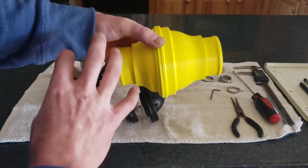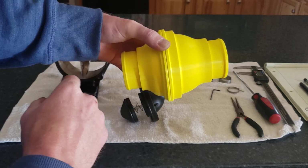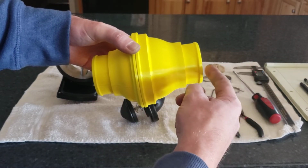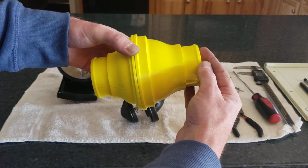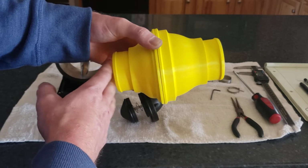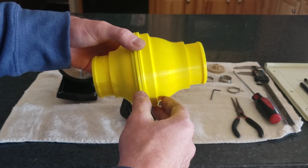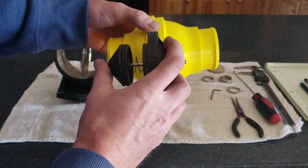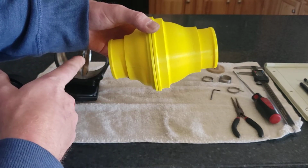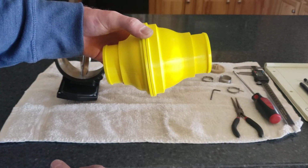And that scenario occurs when the turbocharger is feeding this valve and feeding the eBoosters, and when the turbocharger is generating more boost pressure than the eBoosters are providing, which this side would see any of the boosted air from the eBoosters, and this side would always see any of the air coming just from the turbocharger compressor outlet. So once the eBoosters are kind of out of steam, up towards the higher RPM range, the turbocharger's out-boosting the eBoosters, and this valve pushes open and allows the air to go through the compressor stage of the turbo, be pressurized, and then completely bypass the route through the eBoosters.